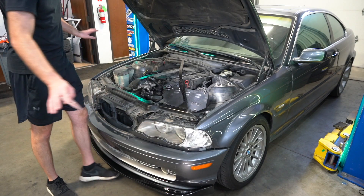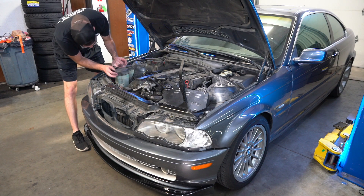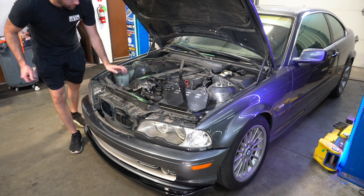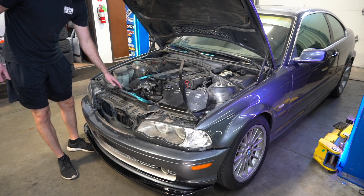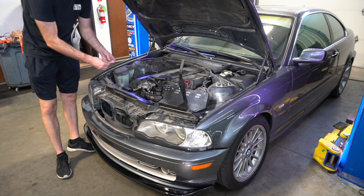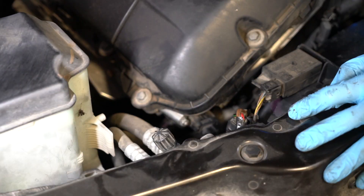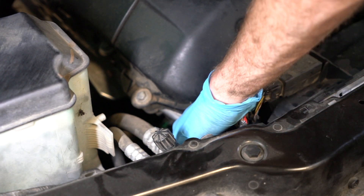It's time to move on to the exhaust side. This one's a little guy — there's not a long wire, just a short little one, and it sits right on this side. I'm going to try not to remove the radiator shroud and the radiator; I don't think you have to. I believe it's another five-millimeter hex. I'm going to get the new one out and ready with its o-ring so we can swap it out quickly. If you haven't already, make sure to subscribe — we've got a lot of BMW stuff on the channel. Right here where I'm pointing is the little connector.